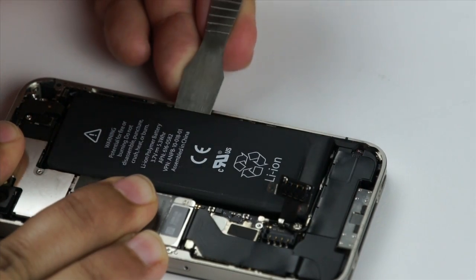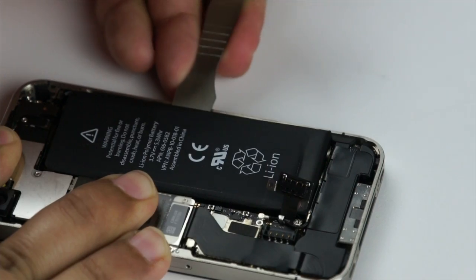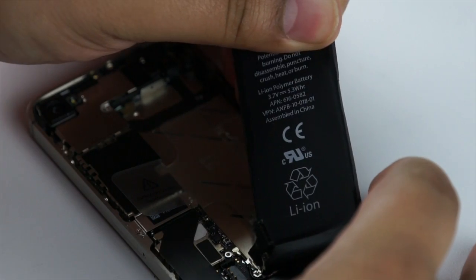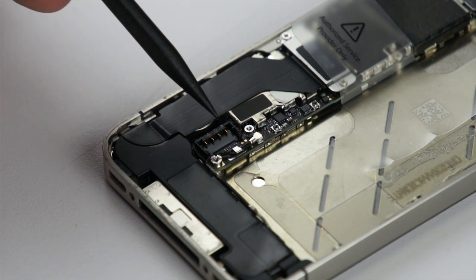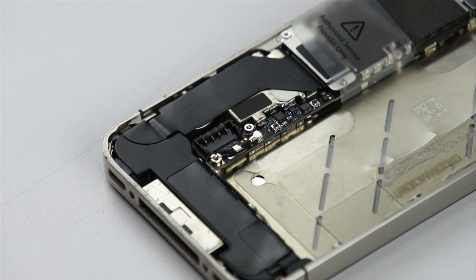You want to make sure not to puncture it, so get in there and gently pull. You'll hear the adhesive come up when you're prying. Don't be afraid to get your fingers in there and pull as well. This is the general area where your components and circuits are on the iPhone 4 and 4s — you want to avoid that general area. Appreciate you guys stopping by, thanks a lot.